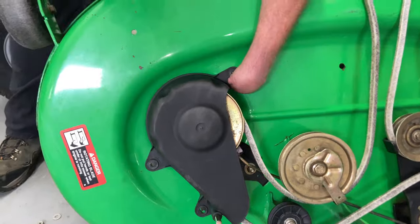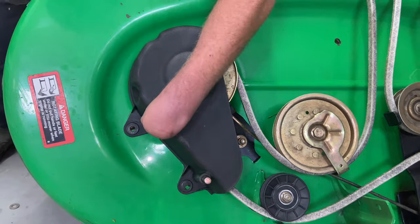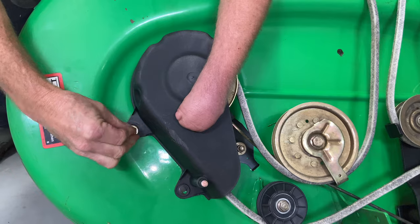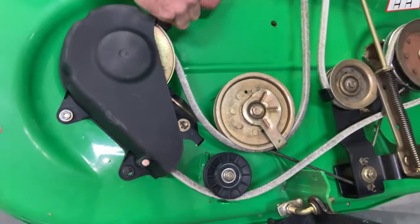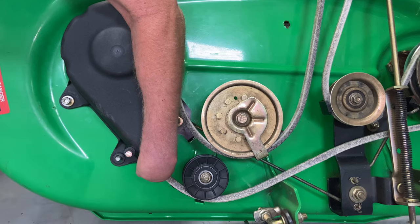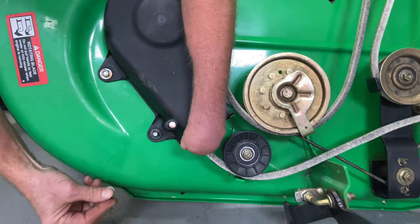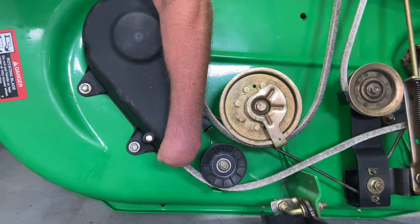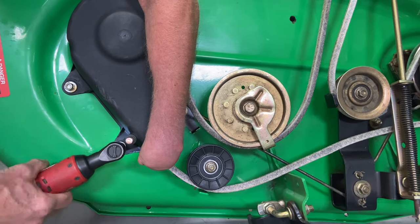There's a lot of comments stating whether or not sealed bearings versus non-sealed bearings, but trust me I've been doing it a long time — just grease your bearings and you'll be much happier and your mower deck will like you for it. So we're going to go ahead and put the cover on the outside here, which is actually a cover slash blade guide. They actually put a metal guide right here that's not wearing at all, which is good. Just putting the carriage bolts back in from the bottom up, and you do have to be careful when you tighten these that you don't tighten them too much because you don't want to crack the plastic.